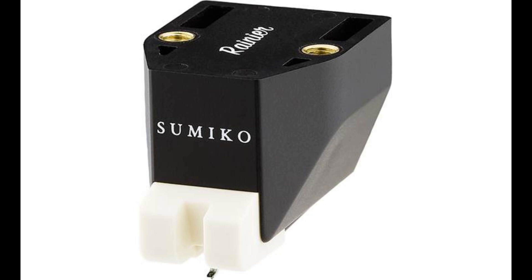It sounded to me like it needed more tracking force. So even though the recommended tracking force is right at two grams and they say 2.2 is the high end, I gave it a little bit more. As far as I could tell, the tracking angle was pretty close to being right on — I mean, you can tell if a cartridge is way heads up or heads down as far as VTA is concerned. This seemed to be right. It matched the tone arm and was not a big major issue. So I don't think this amount of distortion was coming from that — I really think it comes down to the quality of the stylus.